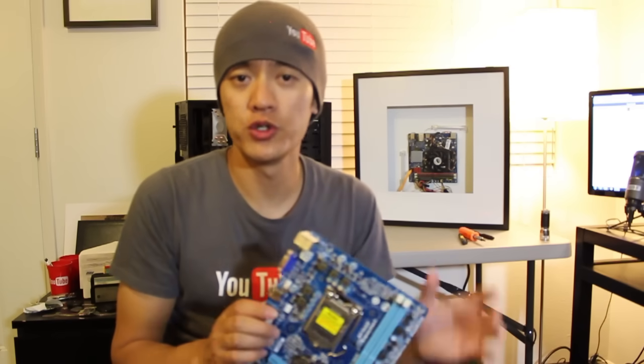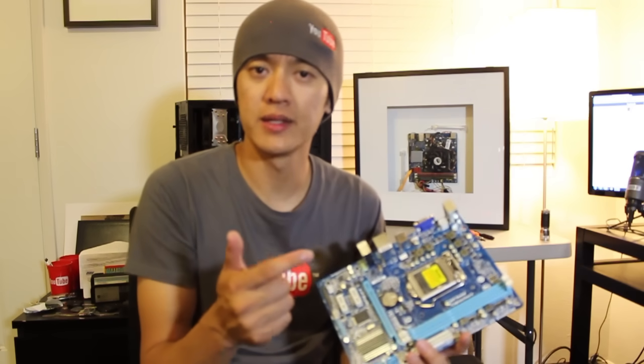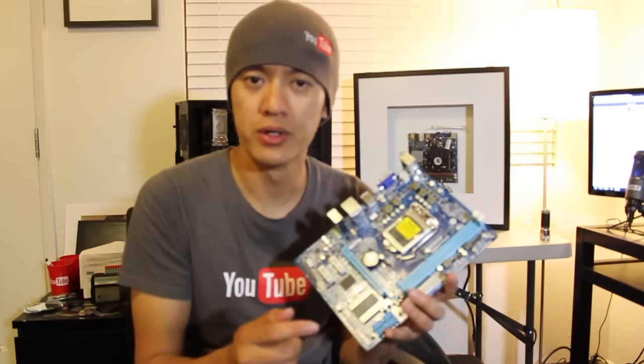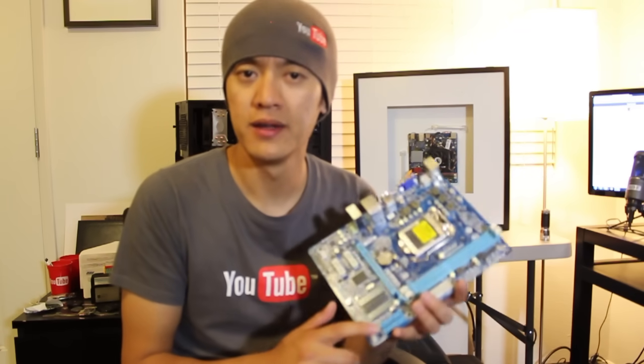Now I wanted to tell you how you can deduce whether or not you actually did reset the BIOS. Before you did any of this, when you hit the power button, the machine would at least kick on — maybe nothing would show up on the screen, but at least the machine turned on. After you do the BIOS reset jumper, when you hit the power button and nothing comes on, most likely it did work — because you went from it turning on when you hit the button, to putting the jumper on the pins, hitting the power button, and then it doesn't work. Most likely it has reset the BIOS. So after you do that, don't forget to take off the jumper and set it back, and then you will have a reset BIOS — if you found the right jumper, did the right steps, and used the right pins.